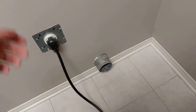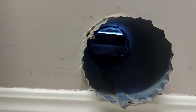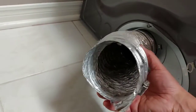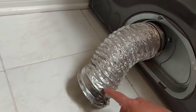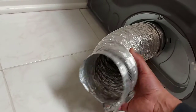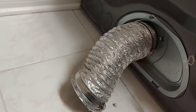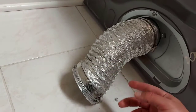Back here is where you want to pull your dryer out away from the wall. This area will get clogged up a lot with lint, and surprisingly this one isn't bad at all. It does have some lint built up on the bottom — we'll clean that out and clean those louvers on the vent cover. But this hose hooked up to the dryer can build up, and you can see a bit of lint in there. I'm going to take this off and clean it out. If you wreck this hose or it gets too built up, you can always get a replacement at your local hardware store, cut it to size — they come with clamps. Just remove the clamps, put them on the new hose, and tighten it up.